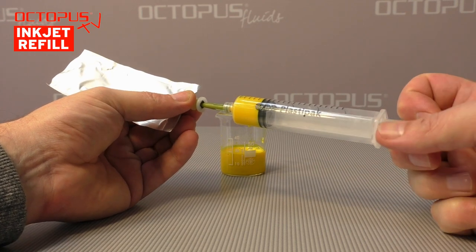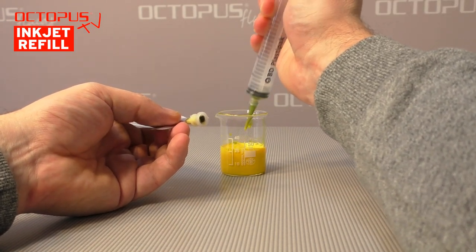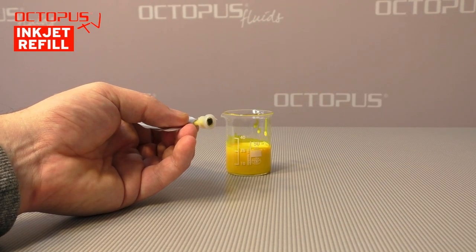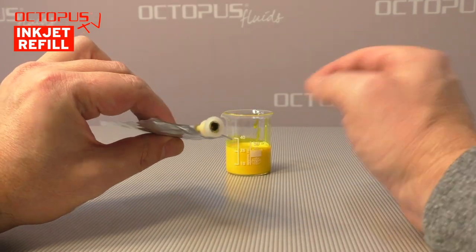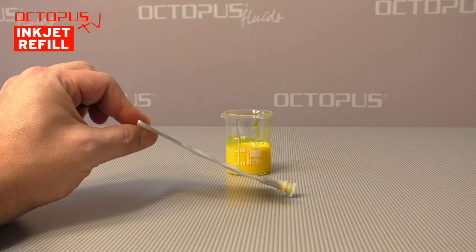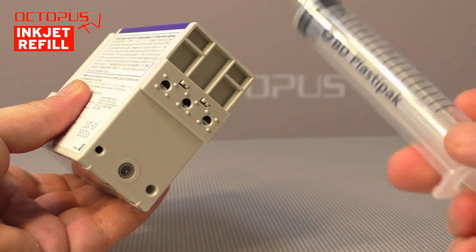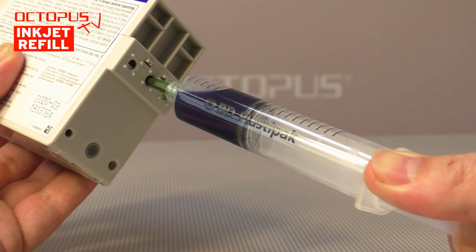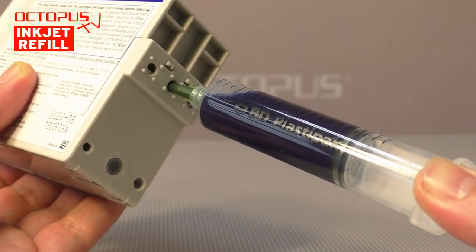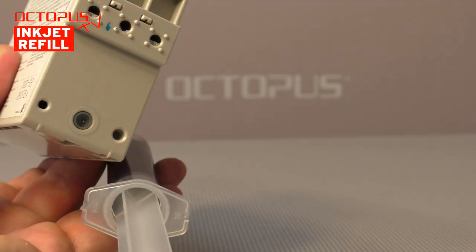Why do we demonstrate the extraction of the ink? In an inkjet cartridge that has been flagged as empty in your Epson label printer, there remains an unknown amount of residual ink in each bag. This ink has to be removed before refilling. The empty bag ensures that it can take in the proper quantity of refill ink. Removing the residual ink and filling in the refill ink can also be done while the ink bags sit inside the assembled cartridge housing. We press the tip of the refill tool carefully into the bag's ink port, open the valve, and extract the remaining printer ink from the bag into our refill syringe.